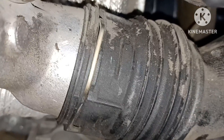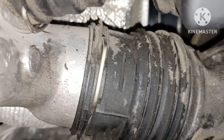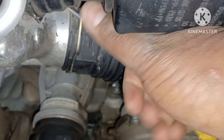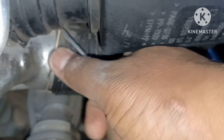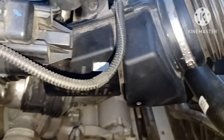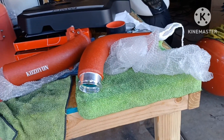That's the charge pipe right there. What you're going to do is pop that piece off — it's just a little pull tab, you pull it out towards you, and the charge pipe slides towards the front of the car. See that little silver or gold piece? It just pops straight up and out because it has two sides — one on each side. You slide it up, pop it towards you and it comes all the way off. Once you get that piece off up top, you've got three bolts — there, there, and one up under there. Take those off and that gets your charge pipe off.